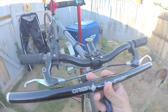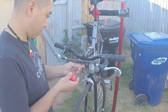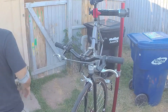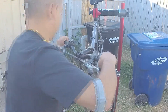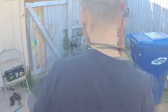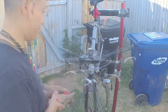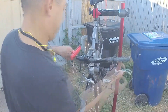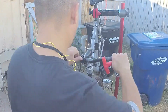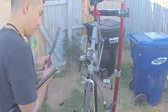But I'm going to put it together right now. I'm using a 5mm T-handle to loosen the faceplate, removing the grips which are very hard to remove, loosening the brake levers and sliding them off. Again, using the 5mm T-handle to take off the faceplate.